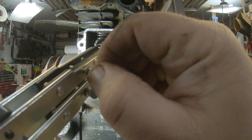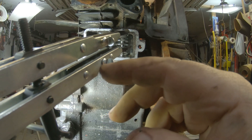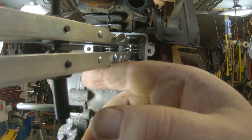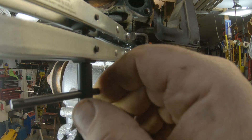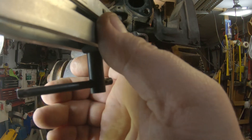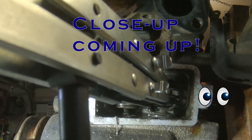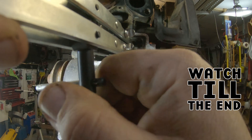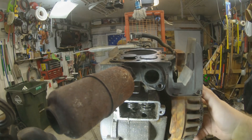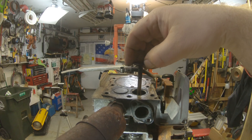What you do with this is adjust these screws so that the gap here — these open and close — and you adjust it with these. Open that up enough so it'll slide in one of the coils of the spring, and your bottom needs to go under the spring. Then just push that in there, and when you turn this — kind of hard to see all this on camera — you can move it up out of the way and get the keeper off. Once you get that keeper off, you can release the tension on your spring, and then your valve should slide right out the top.